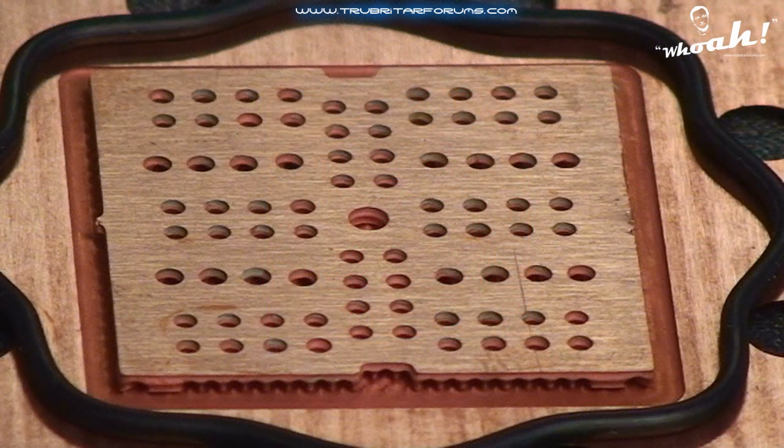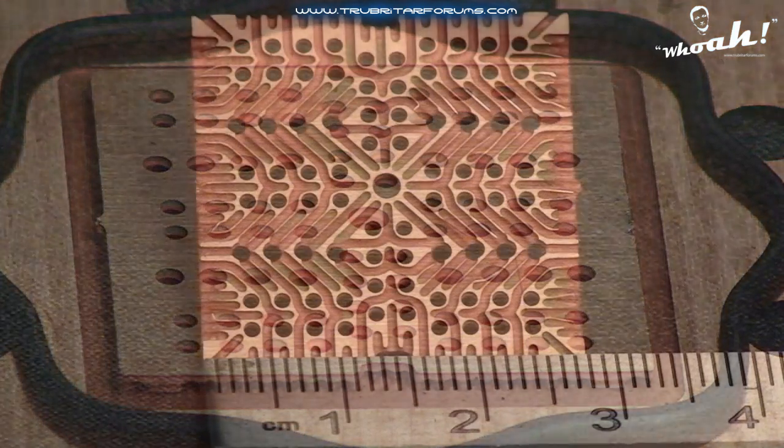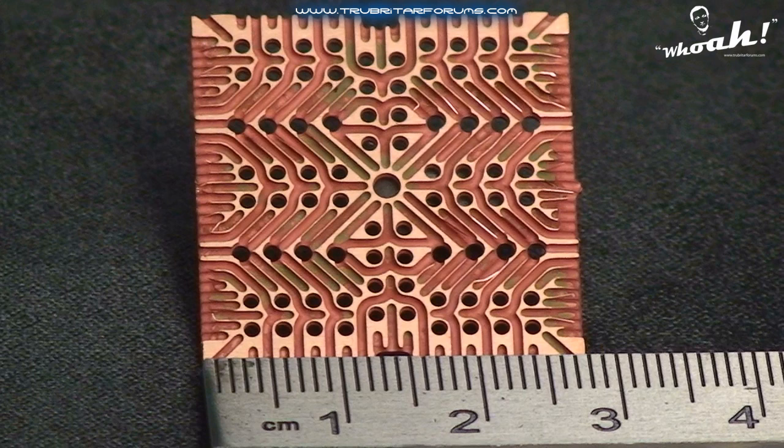Now for the injection plate itself. This plate is also manufactured from 1mm thick pure copper and has been precision engineered with 65 primary injection nozzles and 16 larger return ports. On the underside of the injection plate, things become very interesting. Even though it looks like an extremely bizarre pattern, the channels and ports on the injection plate are optimized to flow coolant to the key areas of the cold plate so that maximum heat transfer from the CPU's cores is achieved. The intricate channel walls are only thousandths of an inch thick, making them extremely fragile — and as you can see here, several were actually damaged during the manufacturing and assembly process. This may have a negative impact on the block's performance during the test, but we'll see what the end results are.